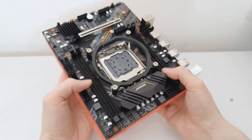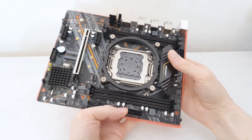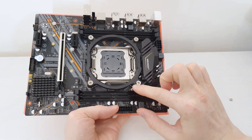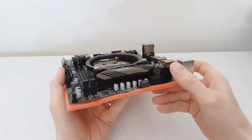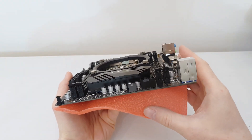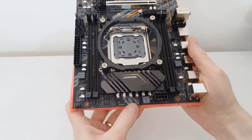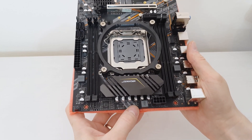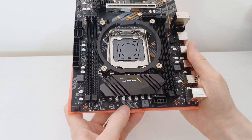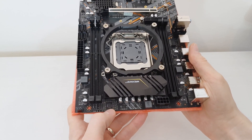There are four memory slots and as far as I know these are quad-channel memory, but what's interesting is that these are DDR3. The VRM radiator is not too big but also not completely tiny. What's bad is that the VRM doublers are still not covered by the VRM heatsink, so they might be overheating.